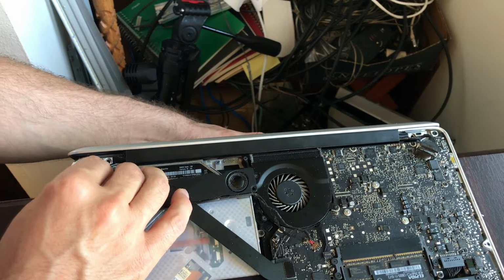So you're going to just keep those tight for a second so you can close the MacBook lid, and then once you do, put it on a flat surface and loosen those two screws. And then you want to check each corner to make sure it's sort of factory perfect, the lid with the body, and then go tighten those screws back down one more time. Then of course add your other two screws.